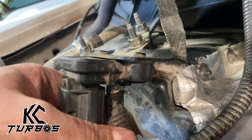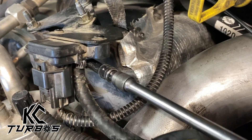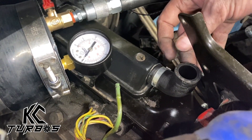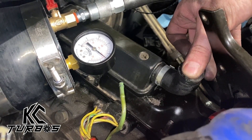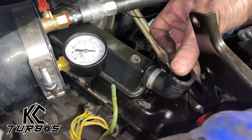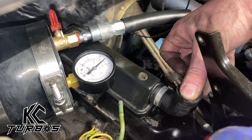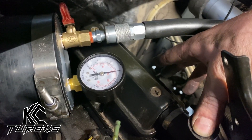It is just so common, and everybody should boost leak test their truck. Now we've got a tight hose clamp on there that is probably not going to leak. There is boost coming out of the crankcase — boost is going to get past the piston rings; it's just inevitable. The intake valve and the exhaust valve don't overlap, so it is not leaking past that. It's normal to have some blowby, and this is not going to affect the performance of the boost system. But you see how it is dropping so much slower and you can't hear any leaks anymore.